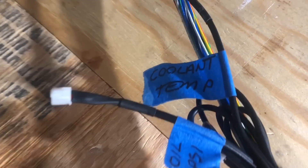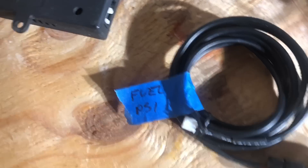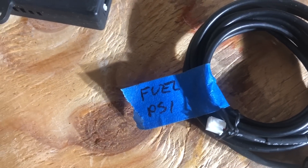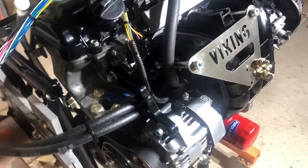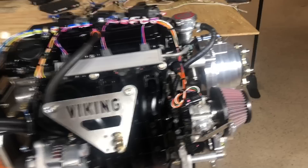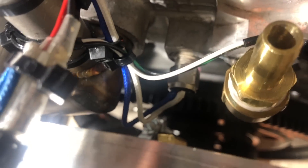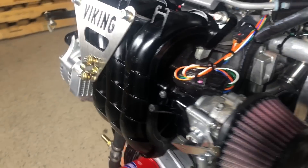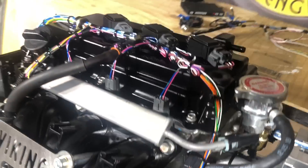Already installed is your coolant temperature probe with its wire ready to plug into your instrument. Your oil pressure probe is already installed, your gearbox temperature is already installed, and your fuel pressure transducer is included so you can screw that into your fuel system wherever the tank is located in the aircraft. It's nice to have this done at the factory because we can bundle the Viking View sensor wires together with the other engine wires — all routed back to the VikingView together.